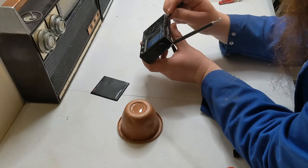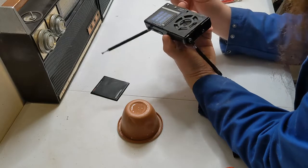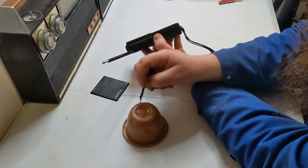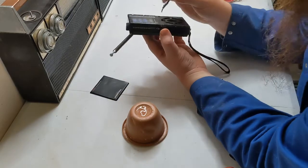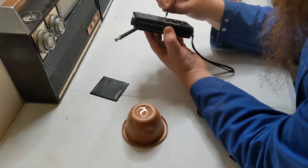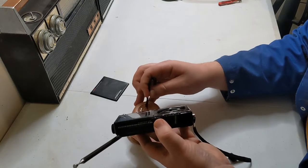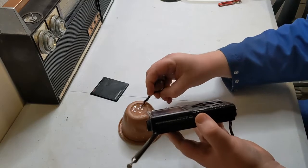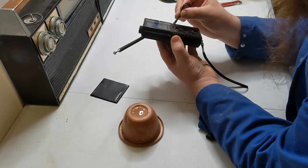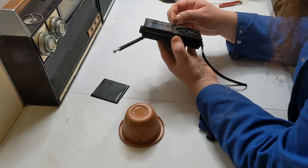Another thing it's good for, that I've used it a lot on, is fixing mugs. If you have your favourite teacup, coffee mug or whatever, and it's broken so the handles come off or someone dropped it, a bit of epoxy resin, put it back together. That's the one time when you do need to use a decent amount, however, because you need to get the seal watertight if you're going to use the thing again. It's perfectly safe to use. It's even dishwasher safe once it's set. Obviously you don't use it before it's set. But yeah, quite a few mugs that I'm quite fond of that got broken I glued them back together. But you do need to use a lot. Crockery is porous, so it absorbs some of the glue and then you just need more.